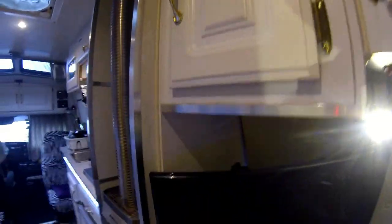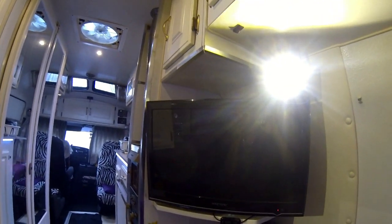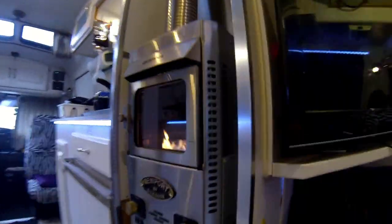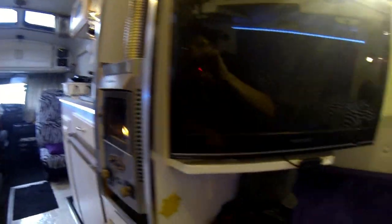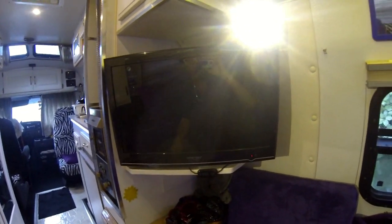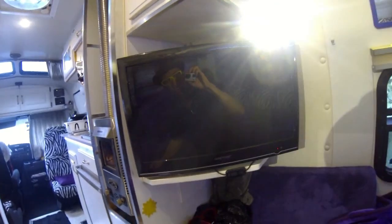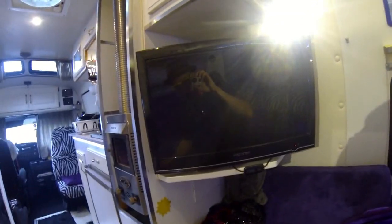And the TV. The TV is a 22-inch LED Majestic Marine TV. These are built for boats. Just like the fireplace, everything built for boats is high quality — shock-resistant, water-resistant, you name it. And it's 12-volt, so I just tapped into a wire right in the back there, pulled it out of the wall and connected the TV. It's always there, it's always on.